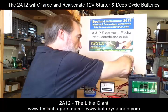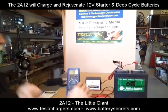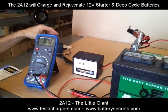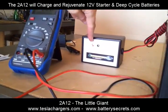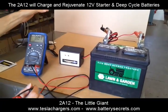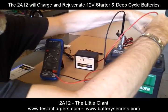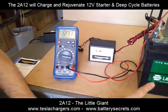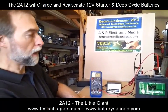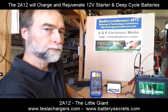Because of that, we also want to connect the charger to the battery before we plug it into its universal supply. So, I'm going to connect it now — you can see that the charge light is on simply because I'm connected to the battery. Right now it's not charging because we don't have any power connected to it. We can see that this battery we're demonstrating is already at 12.71, which is essentially fully charged already. I'm using a battery like this so I can show you what happens at the top end of the charge — what will happen when the charge is finishing.